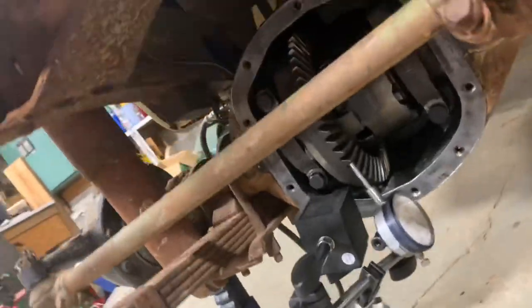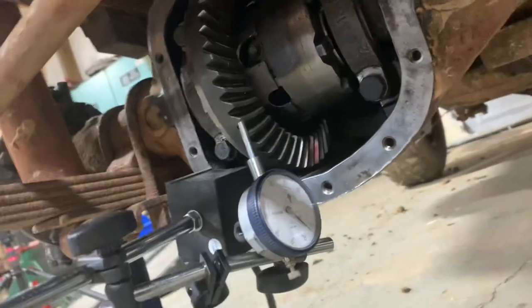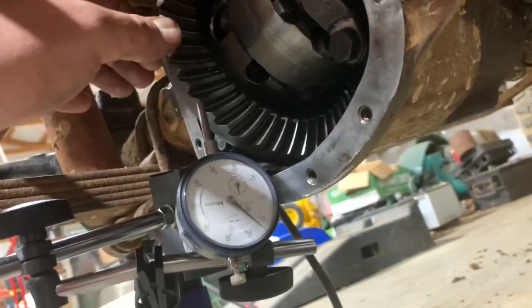I got everything torqued down. I think the book said the caps was like 55 to 70 or something. So I got about 60 or 65 on these cap bolts here. One thing I'm gonna check is the backlash between the ring gear and the pinion. So if you watch my dial indicator here,